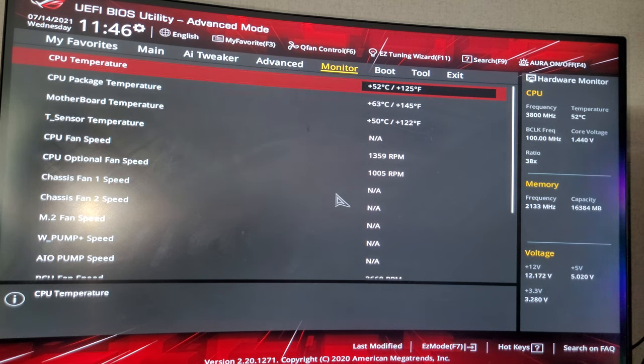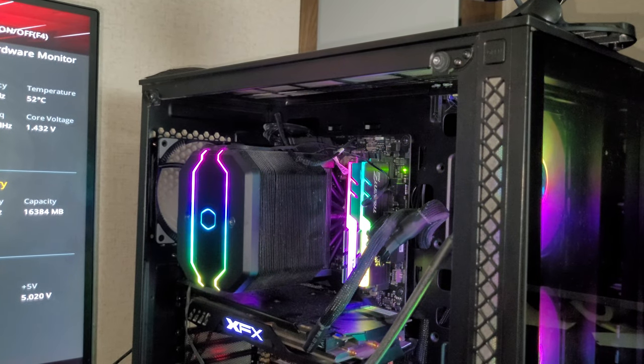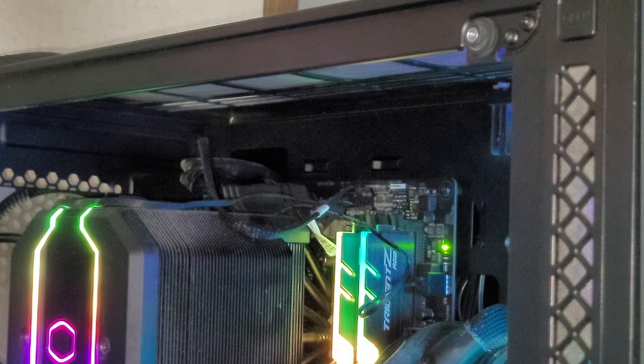For the ones having CPU fan errors: I found a problem with some of these motherboards where some of the stuff is not labeled correctly. Like right here, it says CPU fan — some of the boards make you plug them in at the top. I had a question about the CPU fan error video that I made.